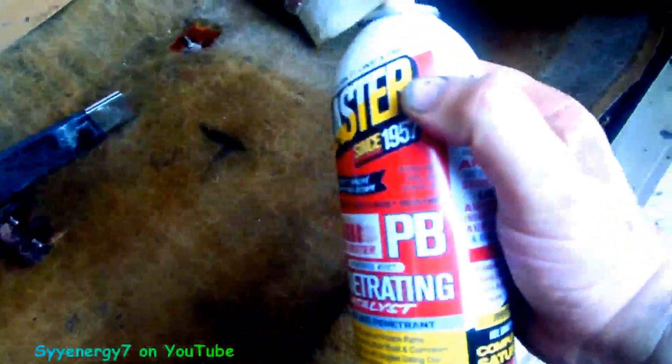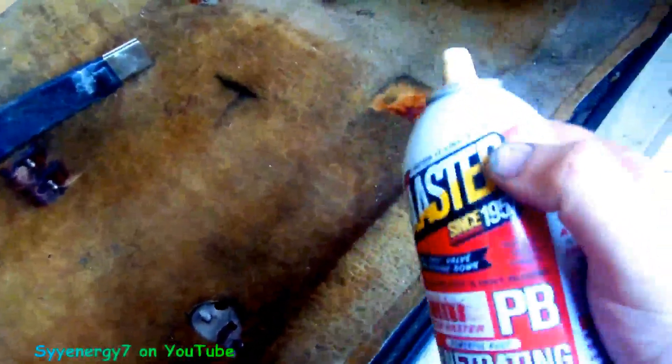This is a '78, so I'm not gonna put these plastic covers back on there again. You can see there's a little surface rust here — two bolts on each side in the back, one in the front. Best to get them out with a quarter-inch drive 14 millimeter — it's a 14 millimeter, or 9/16, that's about the same size. I used PB Blaster to get them off. I was afraid of taking these off because I was thinking, are these gonna spin inside of here? But they were okay.